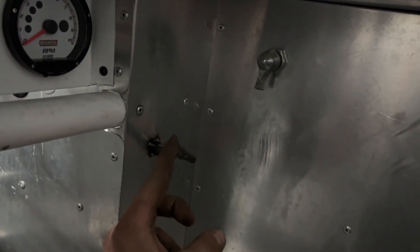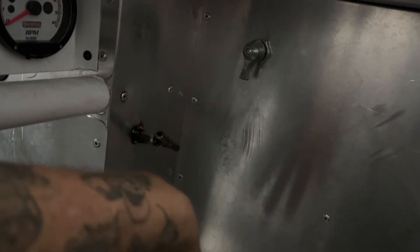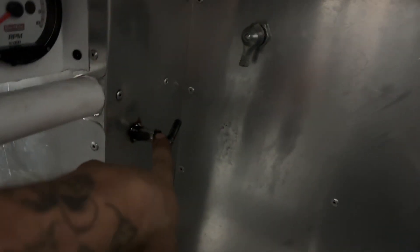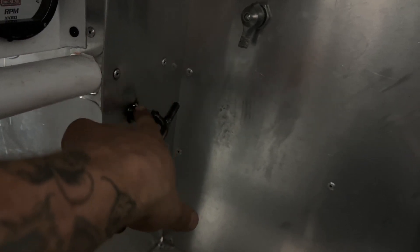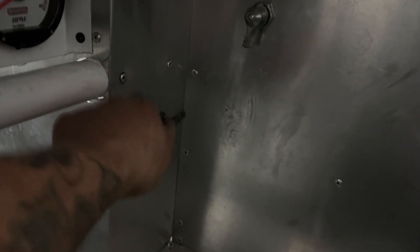This is how I mounted my brake adjuster. It's kind of like an S usually — comes out, comes up, comes out again. That wasn't going to work, so I just cut it and made a little T-handle. It's not as smooth as the S because you can just grab that and go, do a circle pretty fast. This isn't as smooth, so that might be a pain. It just has a little collar here — you weld the collar to the shaft itself, put a mount on it, rivet it. I just tacked it in there because it's not like it's a high-stress thing. It has another one of these little collars on the back side so it allows it to spin but doesn't allow it to move in and out.